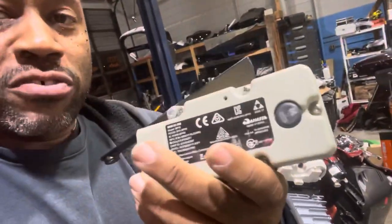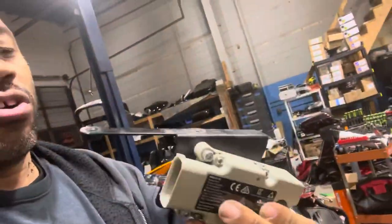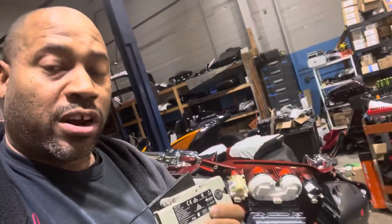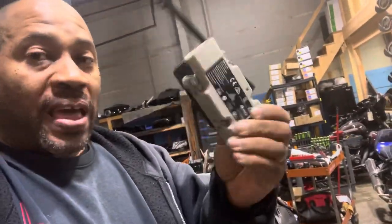For those of you that don't know, this is the WIM module from Harley Davidson. What the WIM module allows you to do is connect to the Harley headset and helmet, and once it connects it enables CarPlay and Android Auto on bikes with the new GTS radio. This piece is like $400 plus labor — you're looking at $700-$800 at the dealer to get it installed. This is a CVO so it came with it already. When we flash the new GTS radios, it tricks the radio into thinking it's connected to the WIM module, so you don't need it. Even on CVOs that come with it, you can't use CarPlay and Android Auto unless your helmet is connected. So if the battery dies or you're using a half-shell helmet or no helmet in states that allow it, you can't use CarPlay. We can flash the radio to ignore the WIM module and just let CarPlay and Android Auto work freely.